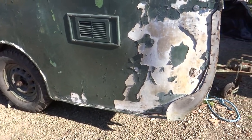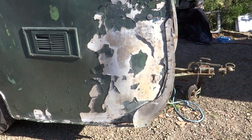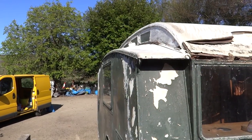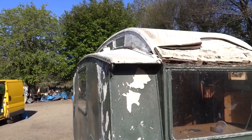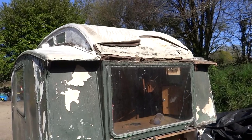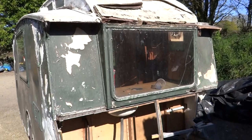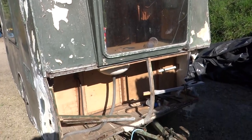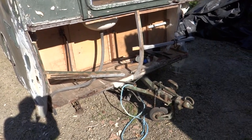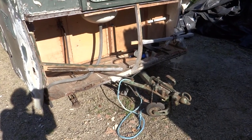As you can see there's quite a bit of rot, and even more so as we go around the other side of the vehicle. The roof is in very poor state at each end. Quite a few of the main braces will have to be replaced, and the entire roof coverings. When we pan down you can see that most of the front frame will need replacing. I shall probably use laminated oak to make up the framework.